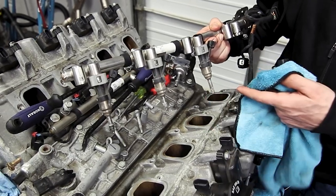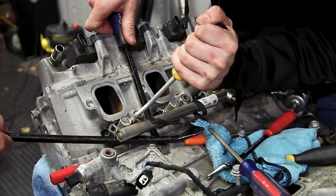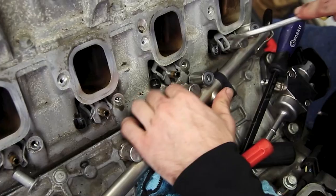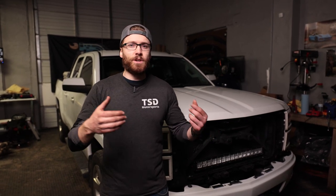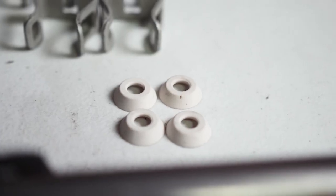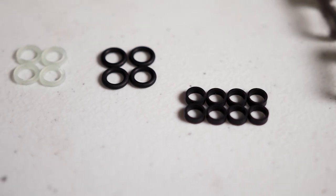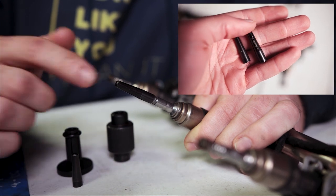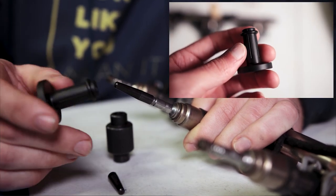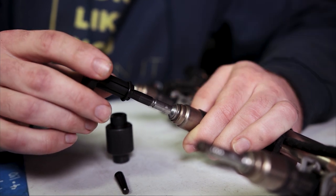The first time we built the original motor, we had new fuel injectors and one new fuel rail, and we found a tool that works better at pulling those fuel rails out so you hopefully don't end up bending your fuel rail like we did the first time. This time those were brand-new injectors, so we were obviously going to reuse them. But when you do pull injectors, it's a good idea to replace all those seals around the tips because it is a high-pressure fuel injection system. We shot a video and will have a DIY on how to replace those seals — you do need a specific toolkit for that.